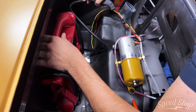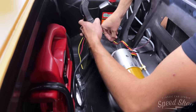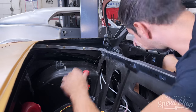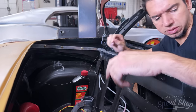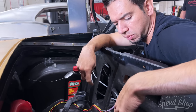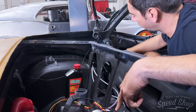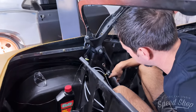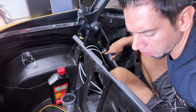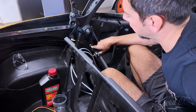You have to bleed the system first? Yeah, you bleed it by running the air out of the system, but right now the reservoir is completely full. I guess they send the pumps full to you, but the rams are all the way down right now, and the lines are empty, so I'll fire it up and I'll push that fluid out into the rams to start filling the rams.